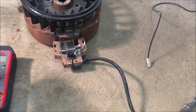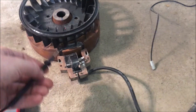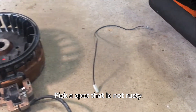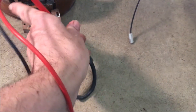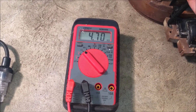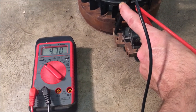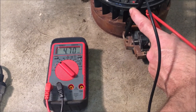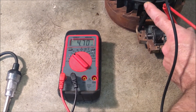If you want to confirm before replacing, you can do a resistance test with a multimeter set to ohms. Put one probe on the body of the coil and the other where the spark plug normally connects. For a Briggs coil, it should read about 4,700 ohms. Four to six thousand ohms might be acceptable, but once you start getting above that, be suspicious of that coil. If the reading is very high or shows an open circuit, just get a new coil.